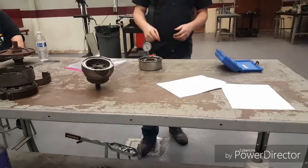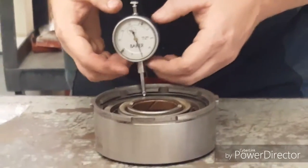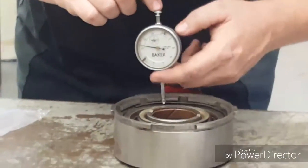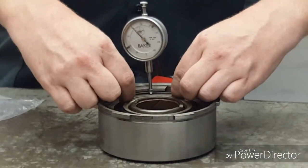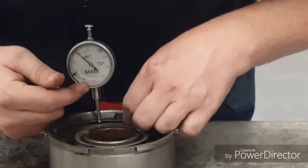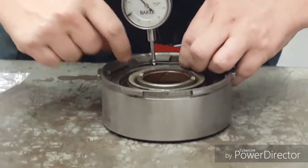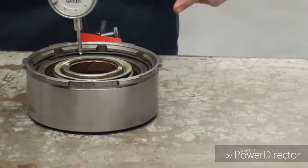It looks much better. So what I did is get these things straight up and down on the surface you're pulling against. I simply set this up, bring the needle to zero — on this one it's straight down. All you have to do is lift up on the clutch. I'm going from 0 to... let's see if anyone can read where I'm going here. That's 40 — so that would read 0.040. All the way around this is just 0.1. The only problem I'm running into is there's still a little bit of space because this wavy snap ring is a little bit of a cushion against the shift. So I'd really need to get in there and pry harder. This is harder to use with a wavy snap ring versus a flat one.